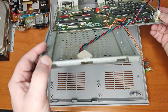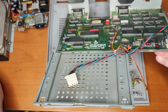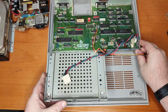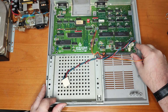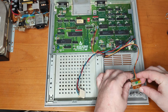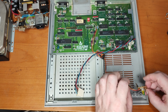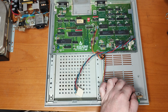Now that little retrobrighting chamber that I used, I left it in there for I think 3.5 days in total, and periodically every few hours I'd just come back, turn it, massage the cream round, and leave it again for a few hours. Kept on doing that, kept an eye on it, and it came out pretty good. So I'll leave you with watching it all go back together.